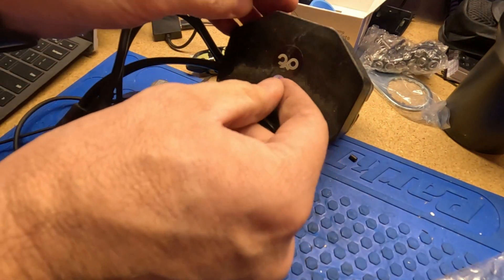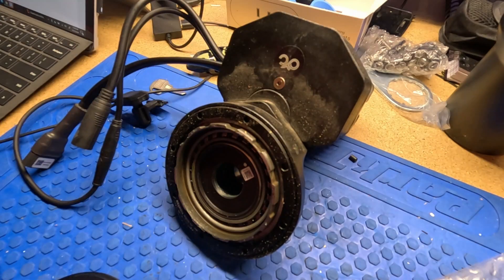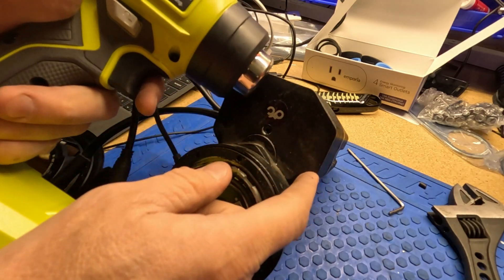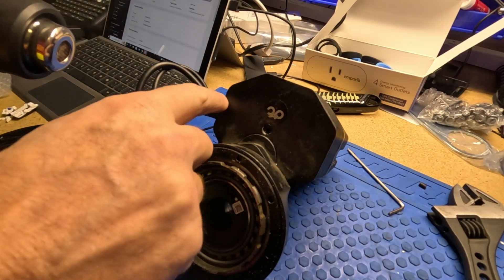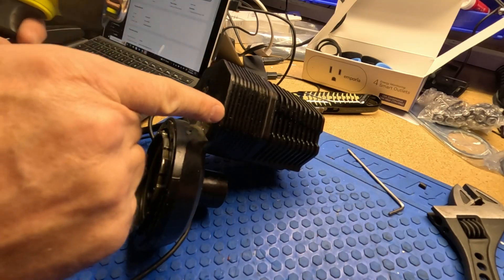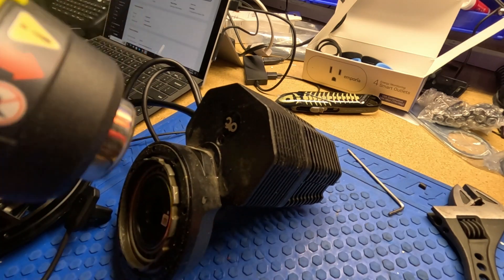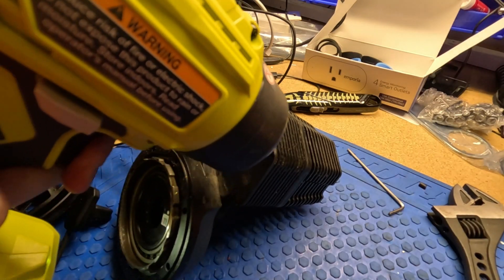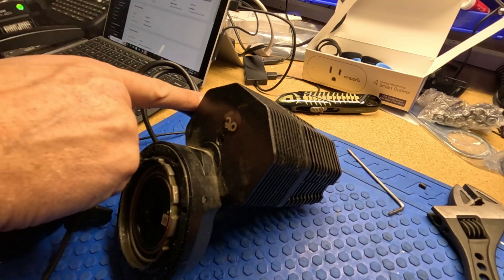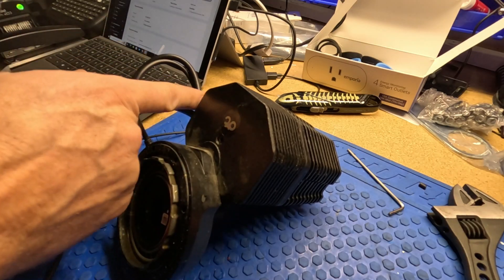Okay, this is now exposing the unit and you want to just pull off this little sticker. You're going to want to use a two and a half millimeter allen. Then take a heat gun and hit around this corner here — pretty much all around — just a little bit to heat that up. There's a gasket right here in this little tiny lip. You just want to heat it up to loosen it. And be careful around these wires — if you're diagnosing it you don't want to damage them.